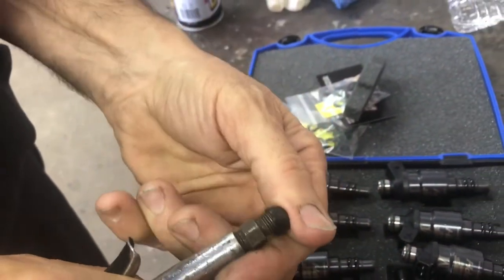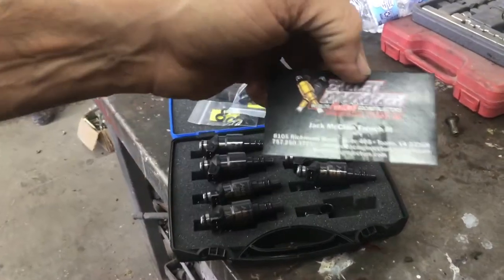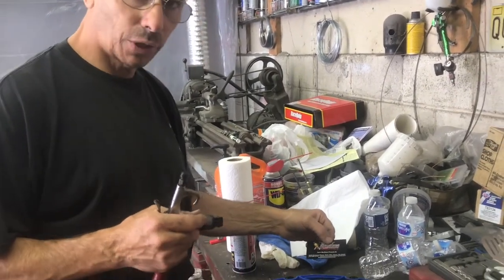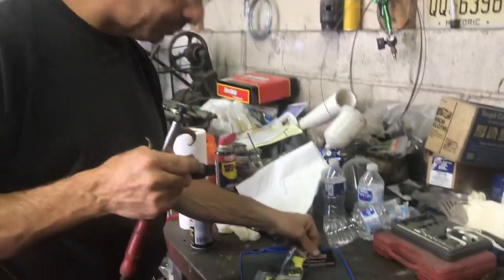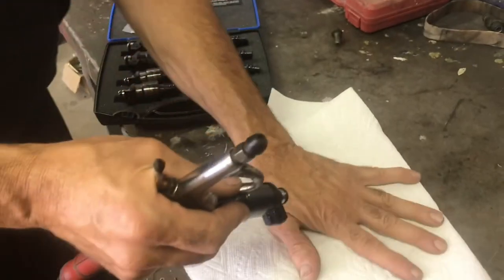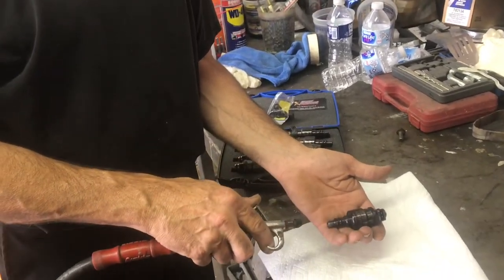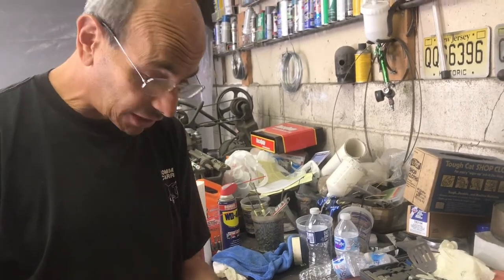We make this little cup that goes on the end — it's a little piece of rubber. This is who you want to call if you need injectors. This dude is awesome. I haven't met him in person but I talked to him on the phone a bunch of times when we were getting the car running. This is customer service right here. We had an injector hang up on us while we were trying to get the car running — a little speck of something got caught under the pintle, under the spring. I called him up and he explained to me how to clean it, but he told me if you really need one, I'll send you one and you send me that one back overnight, and he would take care of cleaning it. He told me he'd send one anyway just to keep as a spare, but I didn't need it. That's the kind of customer service this guy has.